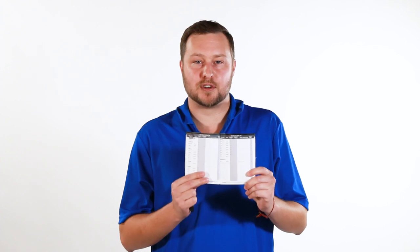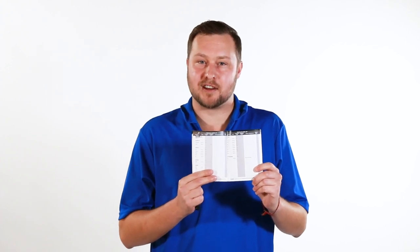If you skip a step, the remote won't work properly and you'll have to repeat the process. To get started, go to the vehicle lookup pages in the user guide and locate the activation and pairing codes for your vehicle's make, model, and year, and write them down on page 4. If a vehicle has two activation codes, try the first code listed. If it doesn't pair to your vehicle, repeat step 1 using the second activation code.